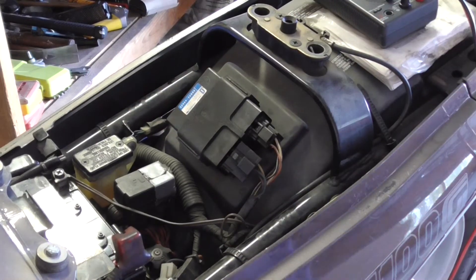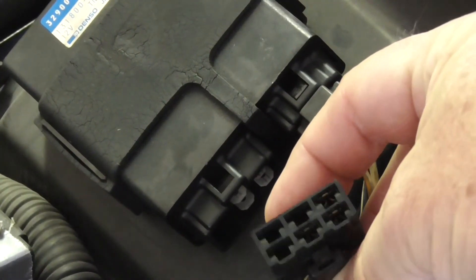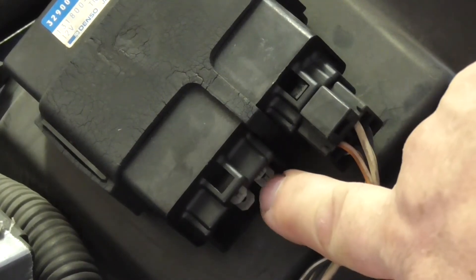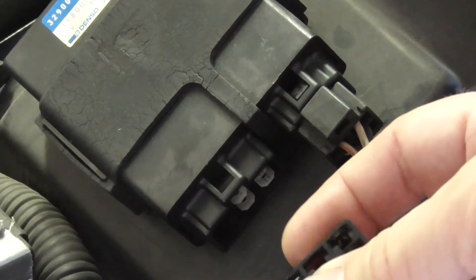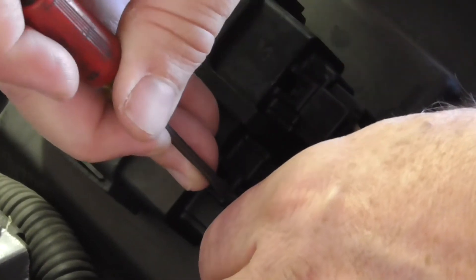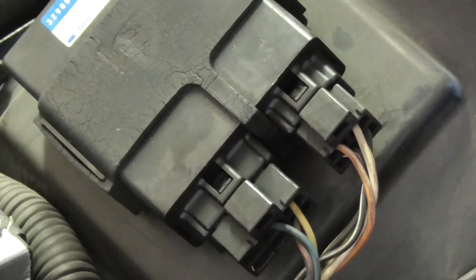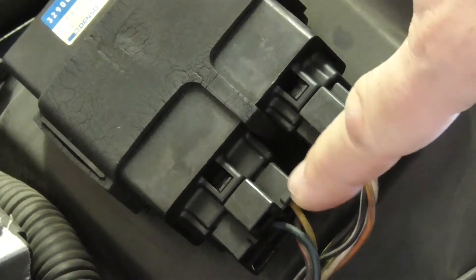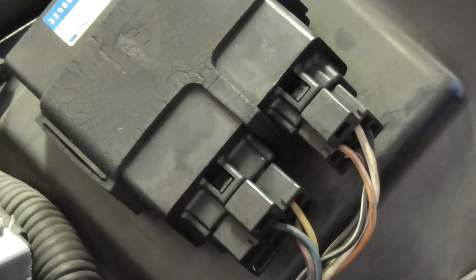Last time I soaked the plugs in WD-40, put it all back together, and it worked. Now, when I take these out, I'm noticing it's got spade-type connectors with spring-type closure things — there should be some resistance when I put it together, but there's not really a lot. I'm not feeling those springs closing in, so I need to increase the spring load of those connectors a bit. It may fix it, may not, but hopefully it will eliminate any problem with loose connections at these electrical joints.